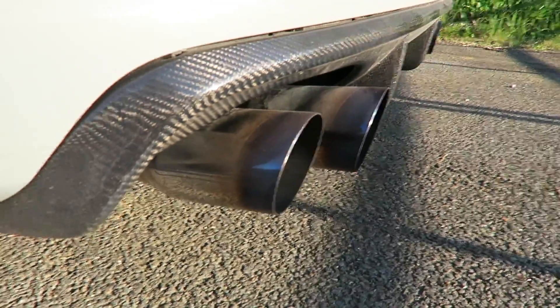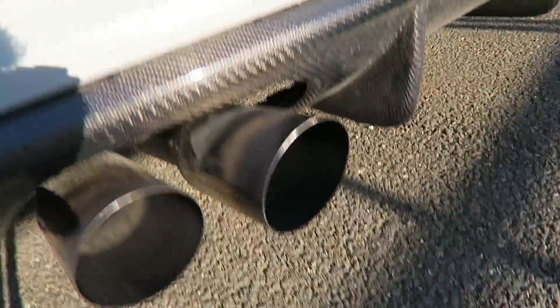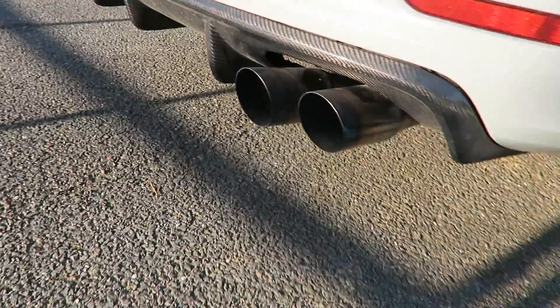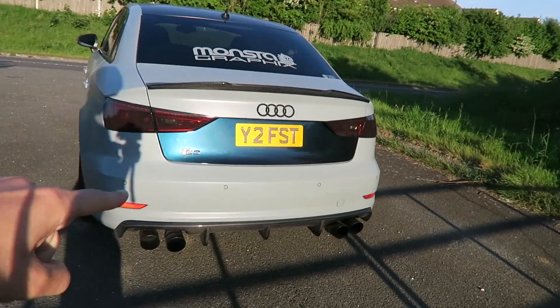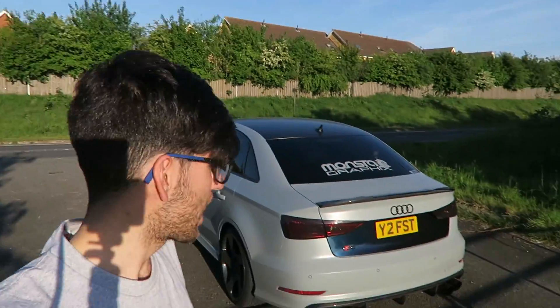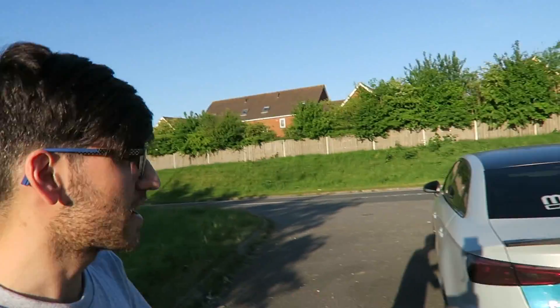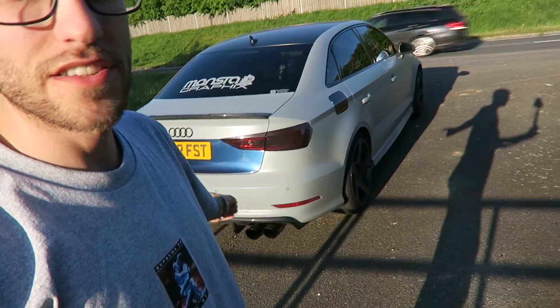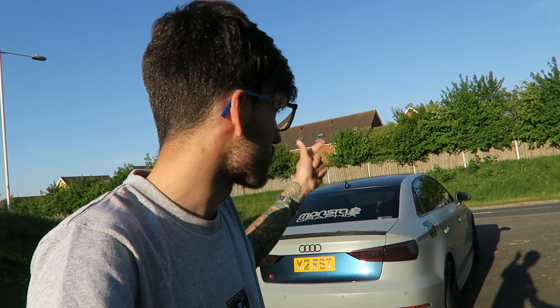So what we've done is told the car that valves are not installed, which means they're open at all times. I don't have the quietness in comfort mode but to be fair it's not too loud inside so it's not too much of a problem. There are the burnt tips, and you can see back pressure out of both tips which confirms the valves are open — it's just quite a nice sound. You might also notice the car is a different colour to before — I'm going to save that for the next video as I want to talk about a few things including some activations and a couple of cool things I've done.